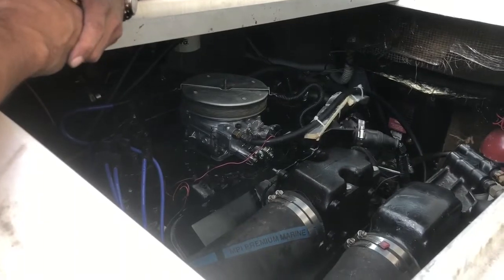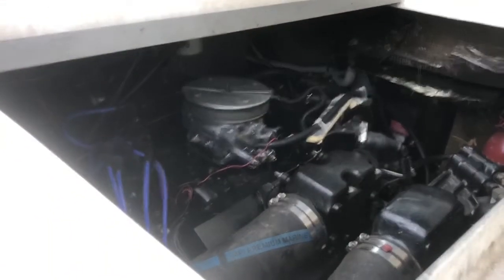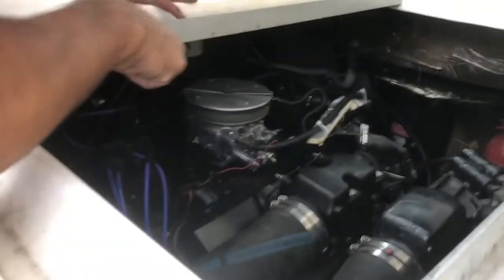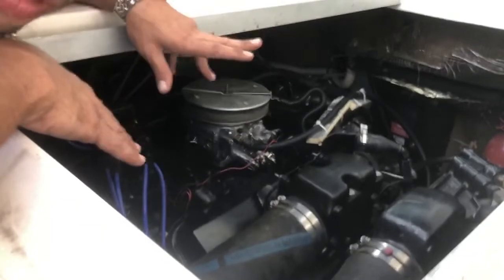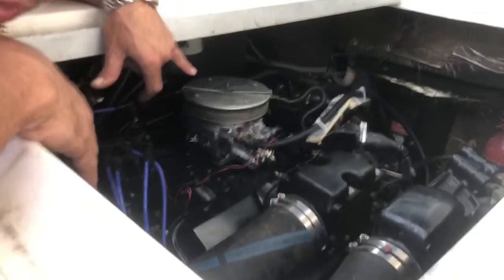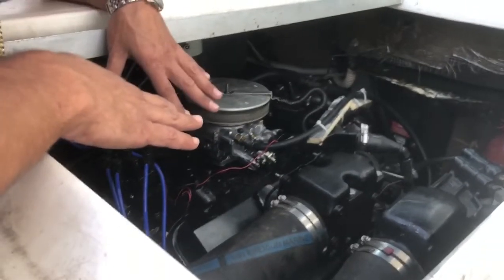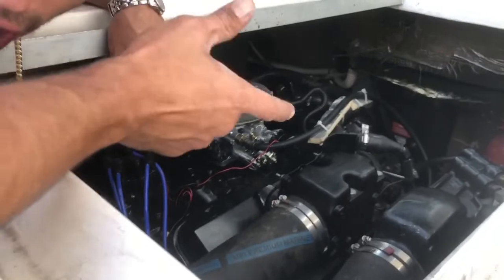I think I opened it a little too much. You might like it a little bit less, but let's give it another shot. Actually, now I don't know. That started pretty good. But see, right after the key, the engine cranked, and she went to normal working condition, where before I didn't like the way it sounded. Even though she gave me a little bit of trouble to start, I still like it better than what it was. So I think I can close the choke a little bit, but I'm gonna ride it out the way it is until I know for sure. But once she cranked, she went to normal operating condition, so I liked it. Before it was too choked up, so it worked. Now I'm gonna turn it off and crank it again, see what happens.